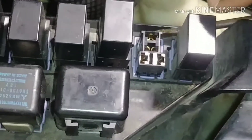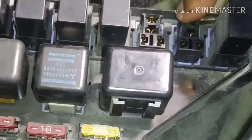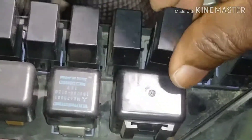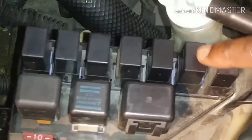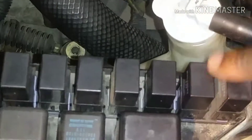Here's the relay. Since I suspected the relay might be bad, I switched the fog light relay with the ABS relay because they are the same type. I removed the ABS relay and put it on the fog light position just to see what would happen. I switched them around, and when I turn the fog light switch, it does click — but the lights still don't come on. So I suspect it's the light bulbs, because the bulbs are old.